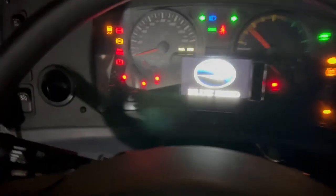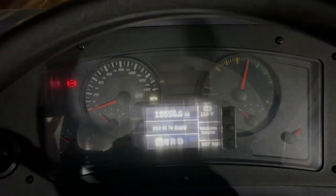I have already unplugged the school bus. The first thing I always do when coming on the electric school bus is I turn the ignition to initialization to make sure that I got a good charge overnight. I'm showing that I have 83.9 miles, which is typical for this bus. I'm going to do the air brake test first on the electric school bus, then go outside and do my outside check, my lights, and then come back inside. I start with air brakes because I want to sit down and make sure that I have a full charge.